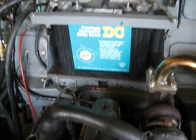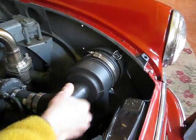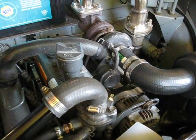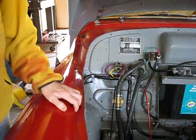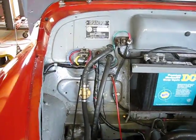Let's have a look at the engine down here. We've got the same radiator from the Morris. The air cleaner was something I got on eBay — it was off a lawnmower or something. We had to make the mount to hold that and do some piping to get it in there. The wiring on a diesel is very simple because there's really no ignition system — there's a solenoid that shuts the fuel on and off to stop the motor, and there are glow plugs, but that's about it. There are no sensors or anything on this motor; it's a pretty simple little engine. That's pretty much all your wiring right in here.